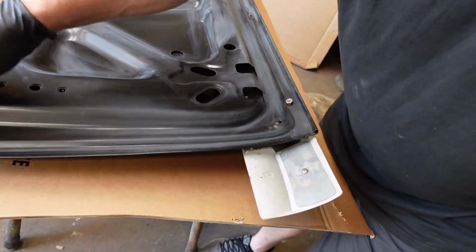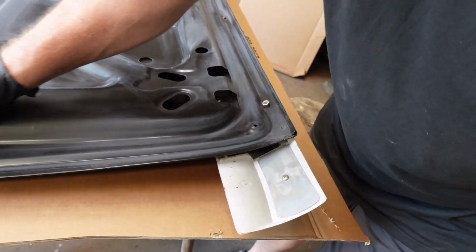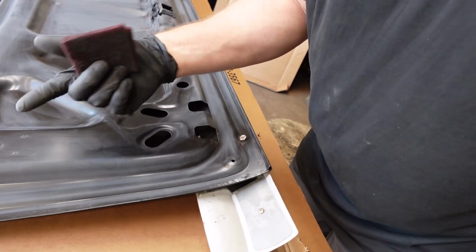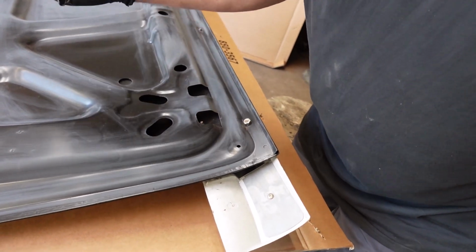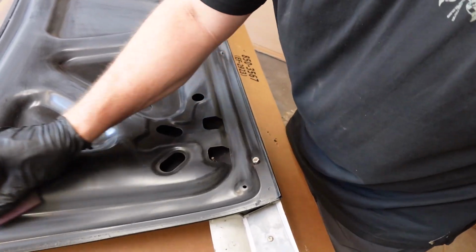That way, when you go over it with the primer sealer from Transtar that I'm going to use, that'll have something to stick to. Because if you do take this off, you're still going to have some kind of etching primer, and you're just going to be building it back up, and you should have just left it on in the first place. So this is the easy tip.